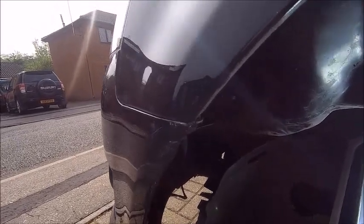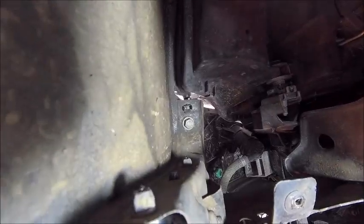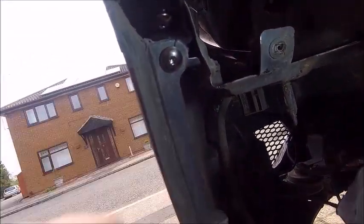There you go! Something to do on a Sunday afternoon. Hope it's been slightly informative, and anybody that's got this same problem understands now what holds it together. Again, if you were taking the bumper off, there are two 10mms on both sides. I would say undo those screws and loosen them off before you pull the bumper out, because that does attach them via clips as well — loads of clips along the bottom which you'll see when you jack the car up and get underneath, those three on top, and the whole bumper will come off. It's not a big job to be honest, it's not bad at all. So there you go — that's another thing sorted. That was bugging me, I wanted to get it looking better, and I think I've done that. Excellent.